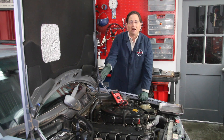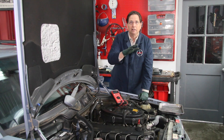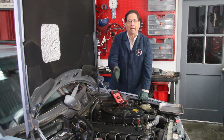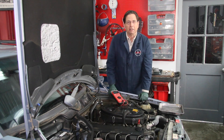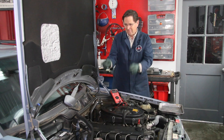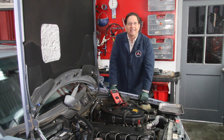When this car came in, I told the owner: don't just jump it and expect to drive it here, because if you jump it it's going to quit again. I said go over there with a fully charged battery, put it in the car, then drive it here to the shop. He did that, and I started it up, got the voltmeter out, put the contacts on the posts, and I was reading 11.9 volts.